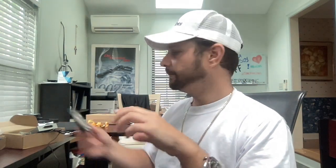If you're buying an original, you'll probably want to get a few specific protocols — they might be $200 or $300 to unlock all the cars of a specific protocol. Sometimes they don't have the files on the internet for virtual read. If you're trying to OBD something via PCM Flash and they don't have the original software on the server, you can bench flash it and send it to PCM Flash and they will upload the original. Please do help out the community if you can do that.